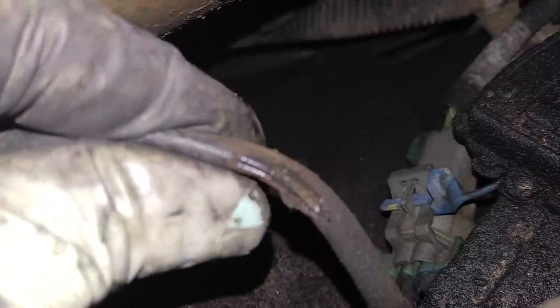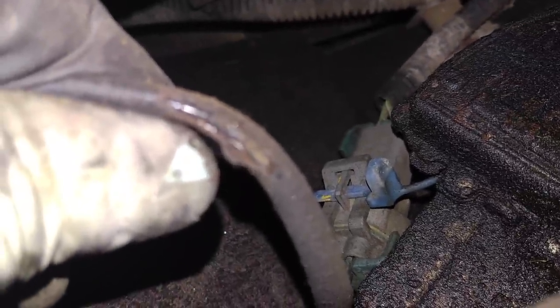Four-wheel drive — a lot of the parts on this truck are made in Mexico. Look at this: the oxygen sensor wire is rubbing on my four-wheel drive shaft. It is rubbed — look at that — rubbed right through. I wonder if it's shorting. I had that happen on the ex's Honda Accord a million years ago — jacked it up to see which tires were out of balance and shorted the computer. Took three or four months to figure out that when I jacked it up the axle dropped and hit the oxygen sensor wire. I think this is rubbing through and that might be causing my check engine light.